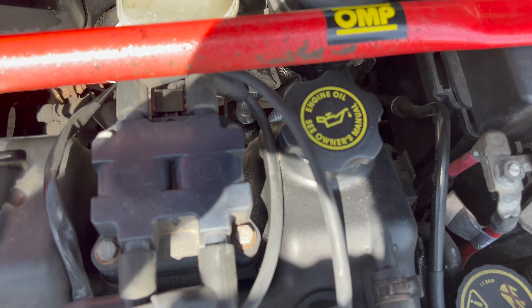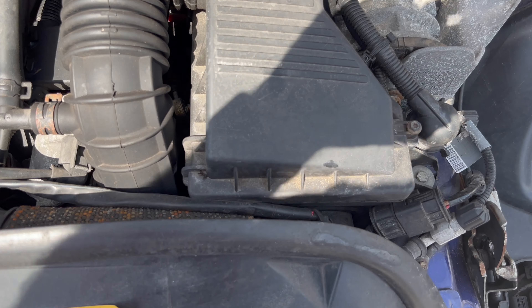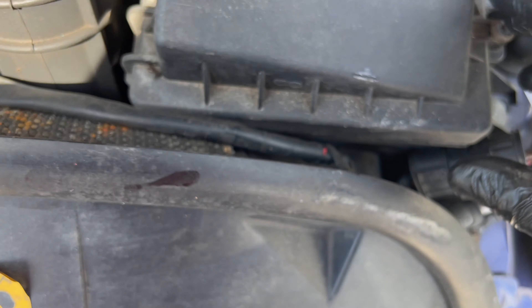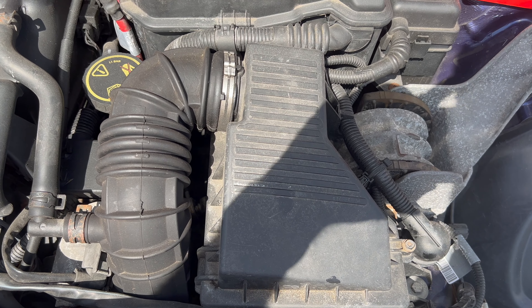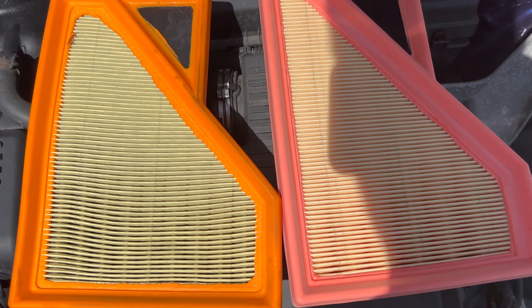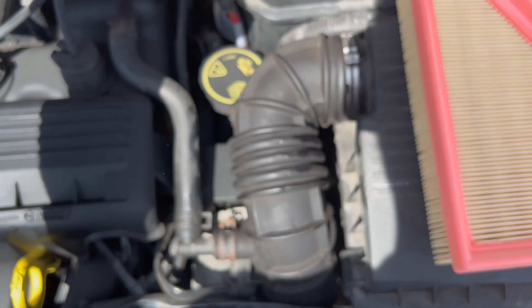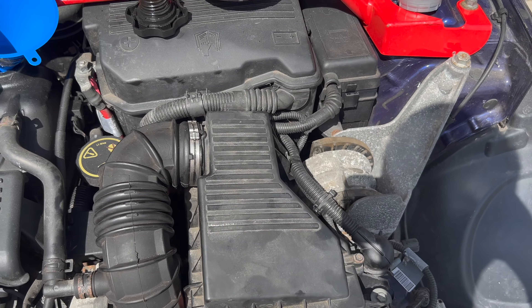While I'm up here it's time to replace the air filter. There's one screw here and a second screw just there — two screws — and the whole thing levers out. Pop out the old one, pop in the new one, job done, and re-screw them back on. The old one has got a bit of dirt in it so it's worth doing. One warning: you do need to remove those cables from their mounting point, so when putting it back on get the two clips in first and then lever it over.